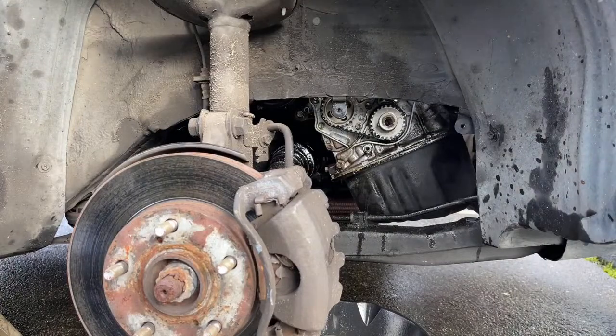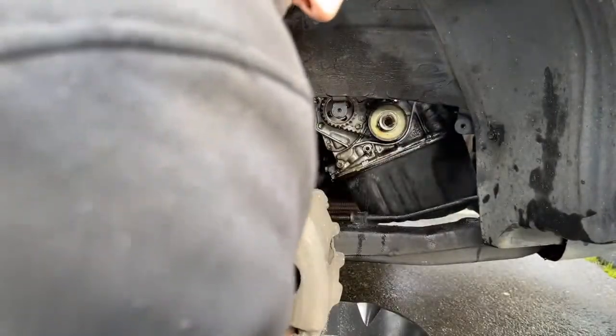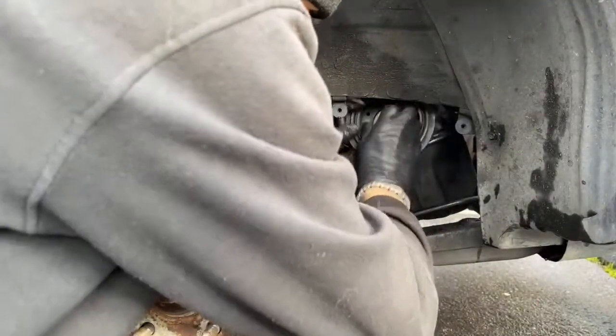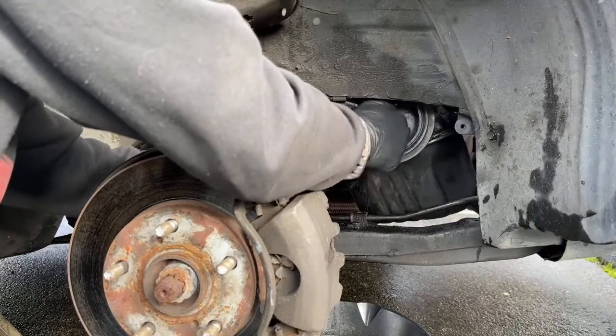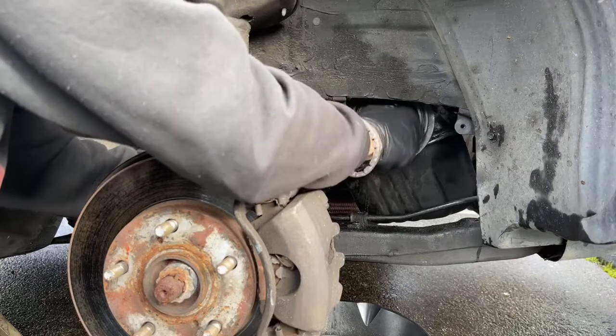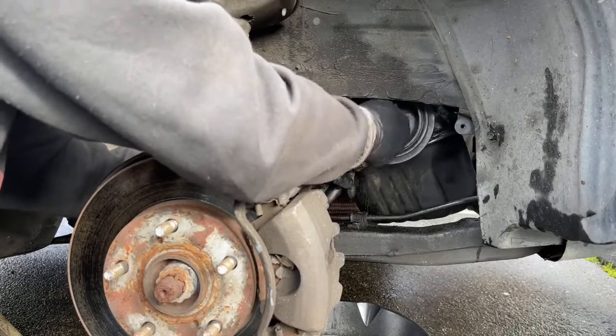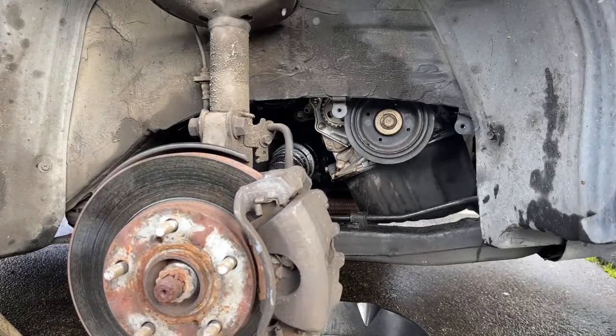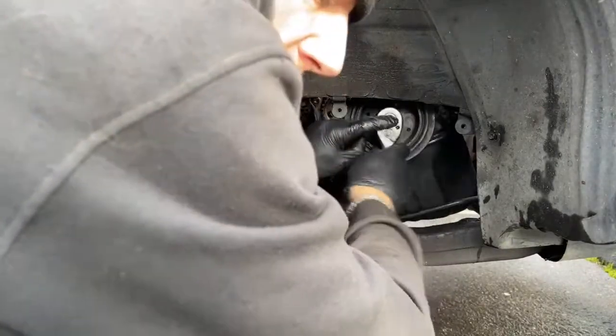Dry for a minute, and then I will start it. And put this crankshaft pulley back on, so that belt sprocket on the belt doesn't come loose. One second. Definitely don't want to have an interference engine belt jump on me. Extension.